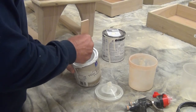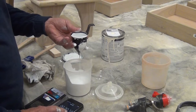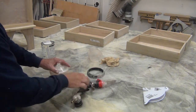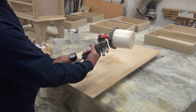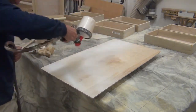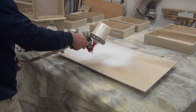It's important to have a good consistency. I usually go for about a 25-second pour, which doesn't work this first time, but eventually I get it down to about 24-25 seconds. Seal myself in and start to spray, using a 3M AccuSpray setup — everything's disposable, though I still have to clean it. I start on a piece that no one's going to see. It's easy to repair, and I check all my spray settings and my flow, then keep going and spray it all out.